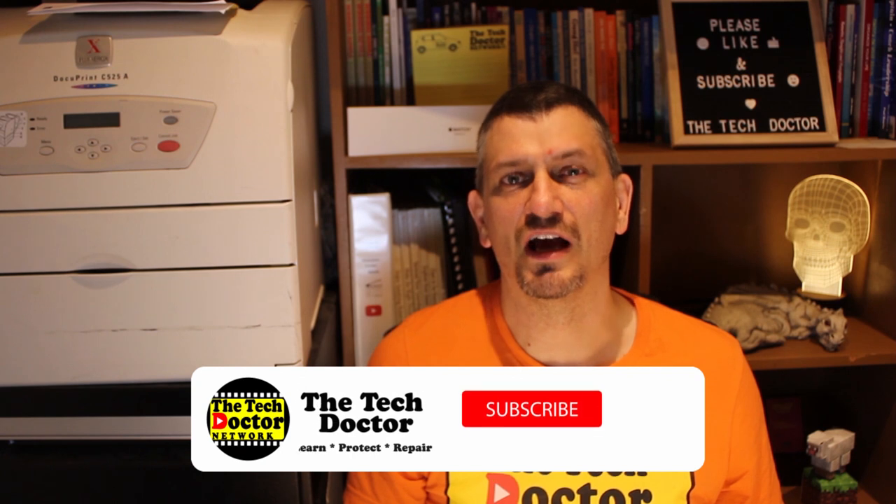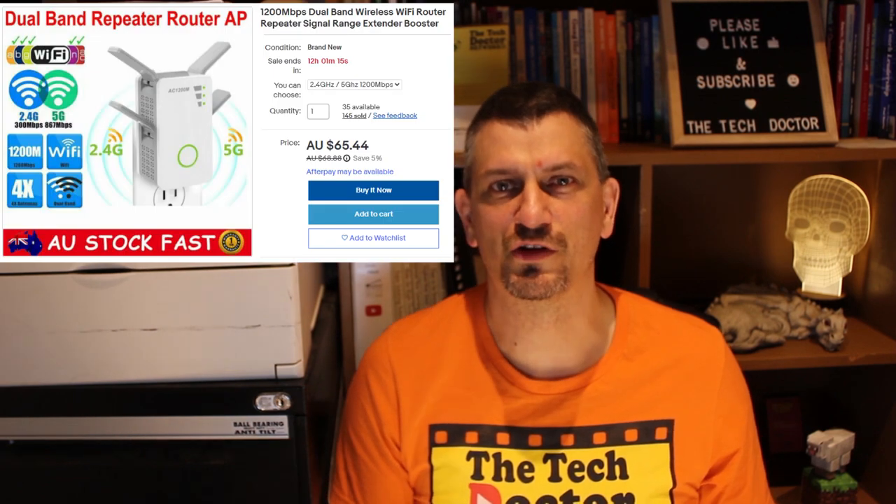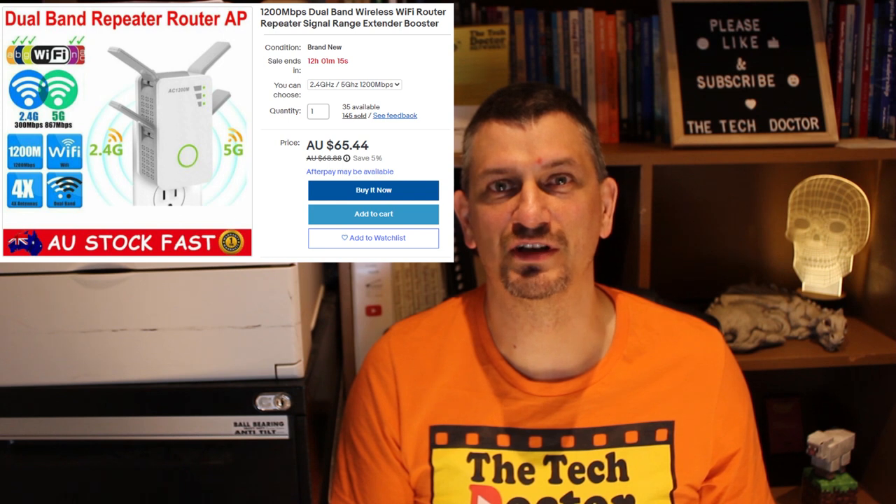If that's not enough, there is some extra hardware that might be a good solution. A Wi-Fi repeater is a device that's plugged into a power point, usually just where your Wi-Fi is starting to fade out. It receives the Wi-Fi and then broadcasts it back out, boosting the signal. These do tend to be quite directional, so it can be a bit difficult if your power point isn't pointing in the right direction — you may be able to fix that with a short extension lead. I bought one for about seven dollars ten years ago, so it's old and only supports 802.11n or Wi-Fi 4, but for the price it was perfect. There are better ones available with great antennas, mounting options, and support for 802.11ac or Wi-Fi 5 for under about 70 Australian dollars. They also often have a network port so that you can cable them directly back to the router if that works better.